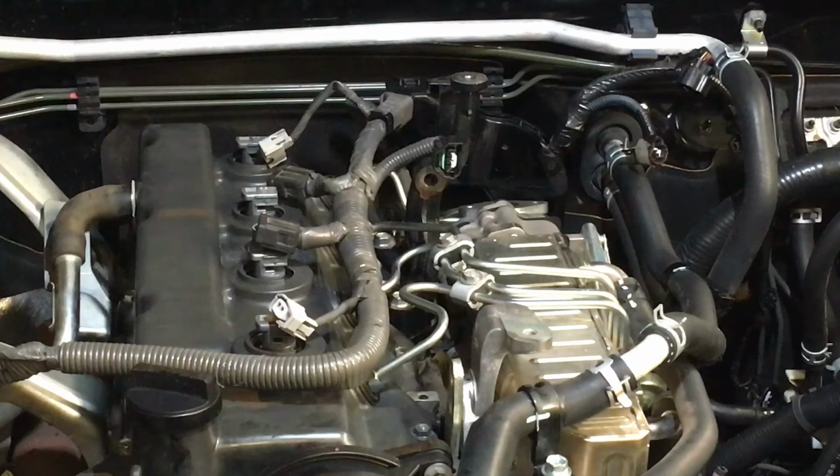Make sure you've got a good battery. Don't do this job if you've got an old dead battery you're stringing out. The average life of a battery is 4 years. So just replace it at about 4 years, otherwise you're going to get caught out one day. Your alternator's going to be working harder and there's more chance it might fail, burn out diodes, whatever. So 4 or 5 years. The original battery, maybe you can push it out to 5, 5.5. I do see them come in at 7, the original batteries. They're really good batteries, but the reserve capacity, just think of the battery. I don't know how to explain it to you best in a nutshell.